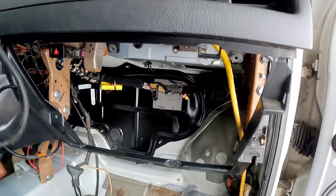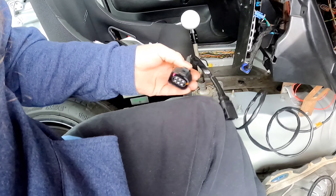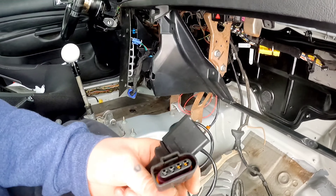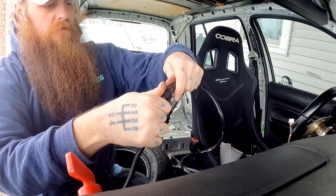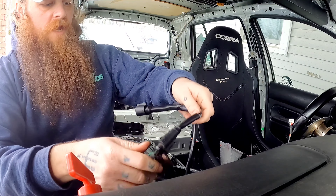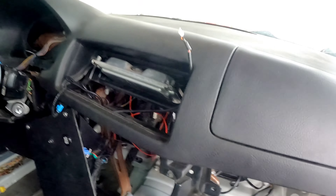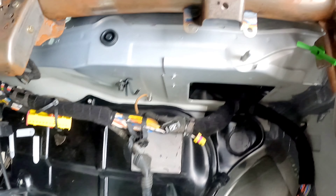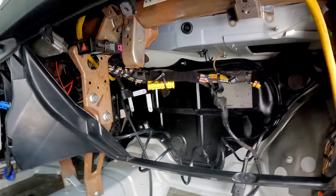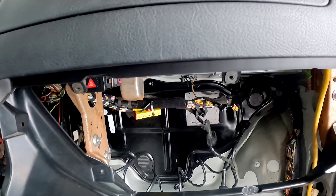What you're basically going to do is — at the end of all that wiring, this is stock wiring — it comes out from where I have the ECU, comes up to here, goes over to here. This end is going to plug into your stock O2 sensor wiring harness. Like so. And then this runs up to your new wideband O2 sensor. The ECU is in, the wiring is attached to the back of the ECU, running up through where the cabin air filter used to be. Just got to tidy up some wiring and it'll be all done. Pretty basic how-to on how to convert your early 1.8T Volkswagen to wideband using Unitronic's conversion harness.